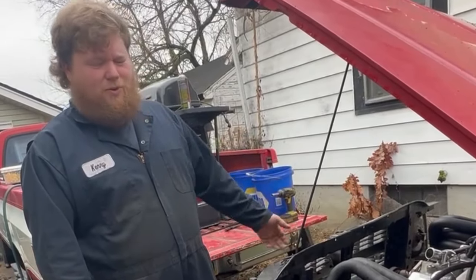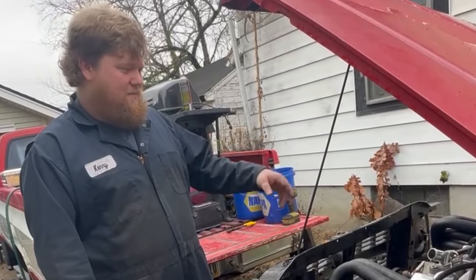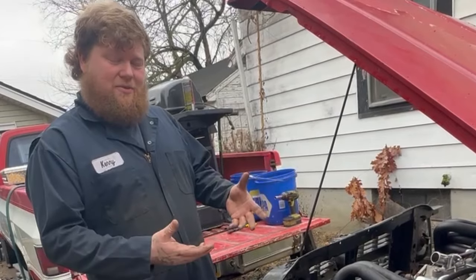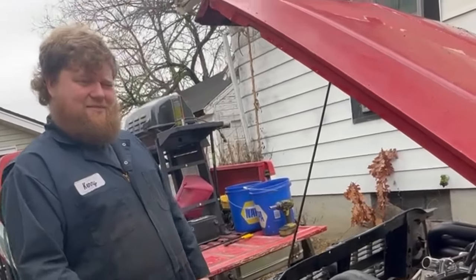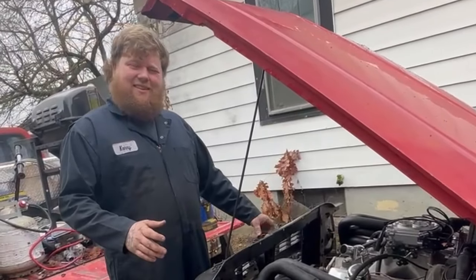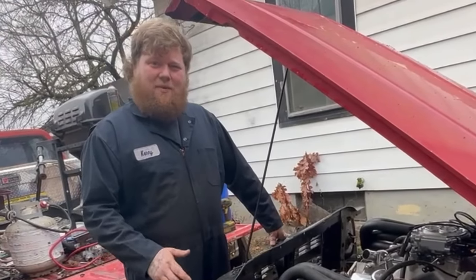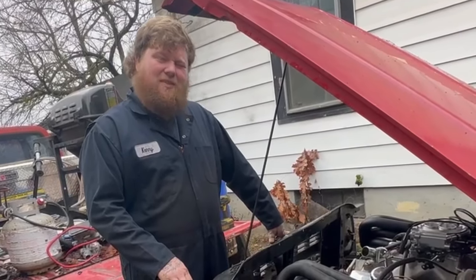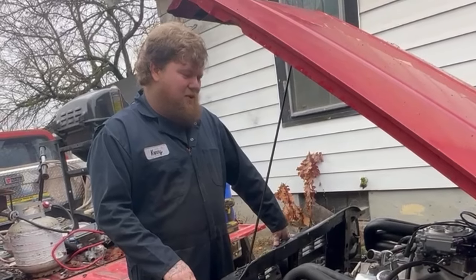It washes all the oil film off your cylinder walls, messes your rings up in the long run, and messes up your cylinder walls because you're running with no lube. It's a bad deal. You don't want rich. A lot of hot rod guys always call it fat and happy. They'll run them a little on the rich side. It's not really that good for them.